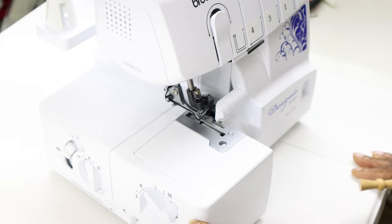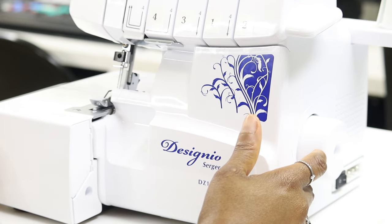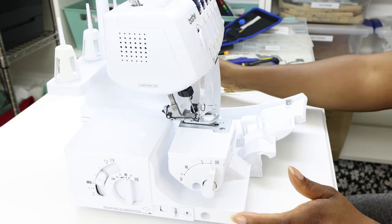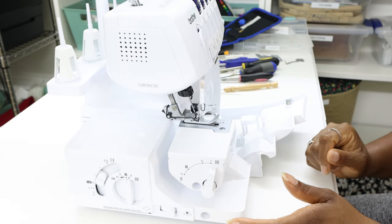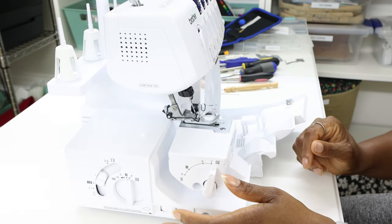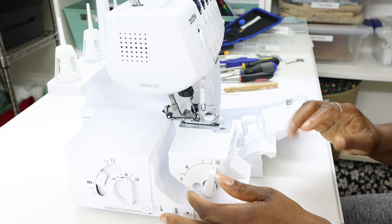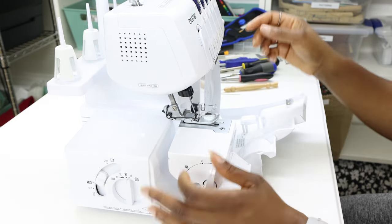So hopefully this video will be helpful. I'll start removing the simpler parts first — pop this off, take off the presser foot and the needles. You probably don't need to take off the needles since I'm not working on the looper clearance in this video, but just for safety and so I don't break them, I'm going to take them off as well.